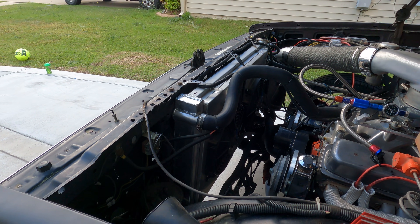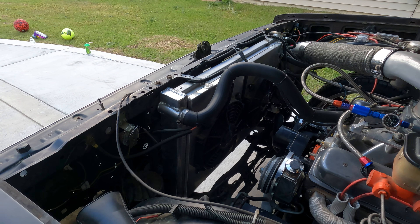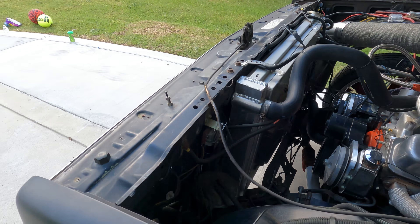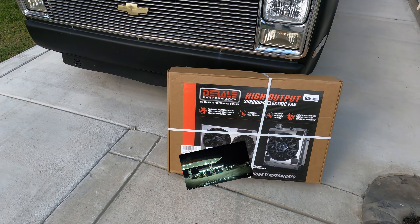When I'm sitting in the drive-thru my truck is overheating — it overheats in the drive-thru, guys. Anytime I'm sitting in traffic the temperature slowly creeps up. It doesn't go rapidly, but as soon as I get momentum going it goes right back down. That pretty much tells me those fans aren't pulling enough air to keep my truck cool.